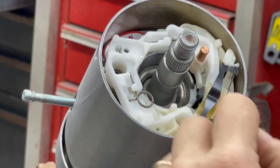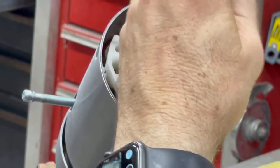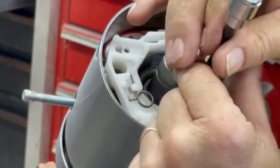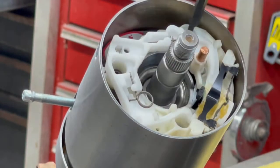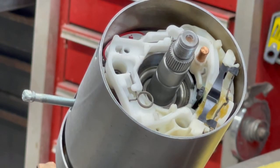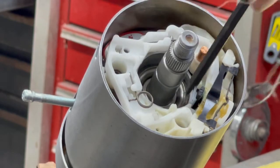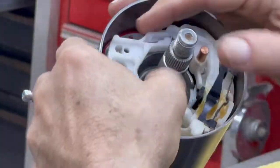The long screw is the one that's on the top if you're sitting in the driver's seat, actually. So it goes down through where a longer bushing is. Remember putting that in? Anyway, you should be able to set these things in like you're watching me, and they go right to the bottom of the threads of the screw with very little complaint. Since this is all brand new parts, it's perfect. And I'm using an Allen wrench on a ratchet. Don't do that. Use a screwdriver, because it is far too easy to over torque one of these guys with a ratchet, right? So now it's in there.